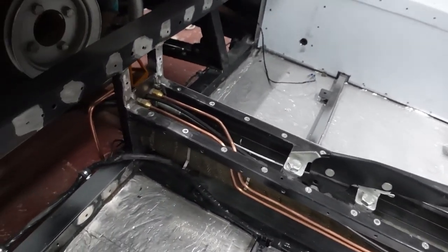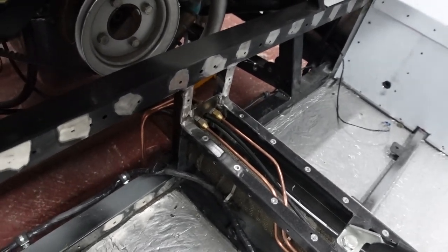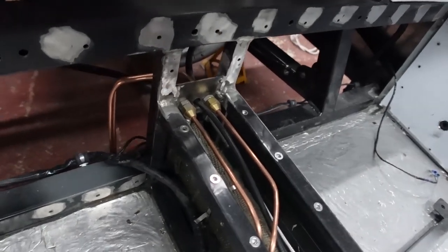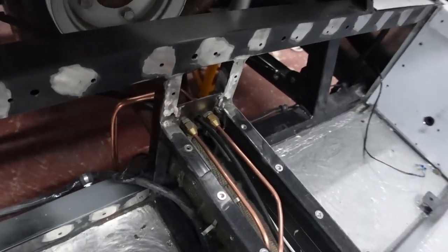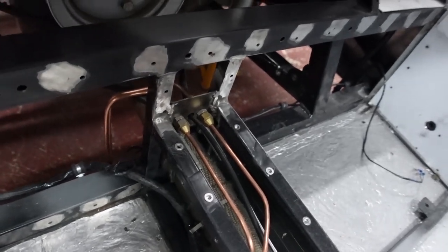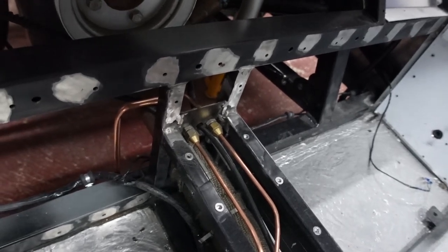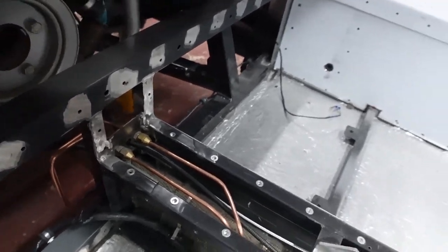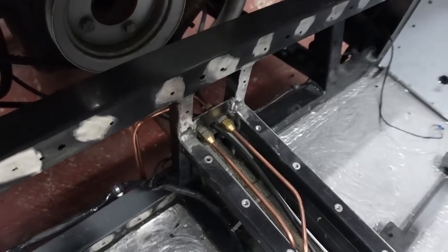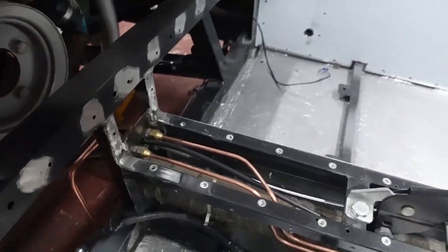I pretty much squashed a P-clip and it acts as a nice spacer. Because these lines are routed so differently to before, there was no way to nicely route them through the rear bulkhead, so I made up a small plate, drilled it for a couple of bulkhead fixings, and welded it into the chassis — giving me a solid point to pass the hard lines through. You'll see the hard lines loop up and over the handbrake cable, with the throttle cable grommeted through the centre.